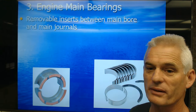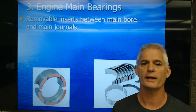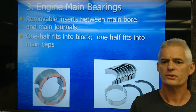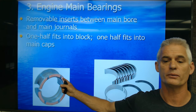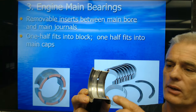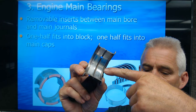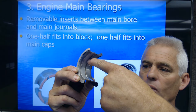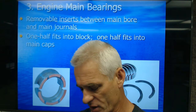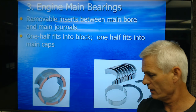I eventually figured it out. It actually ruined the crank — I had to take the oil pan off, drop the crank out, put in new bearings. Cost me $150 and a lot of time. One half of these main bearings fits up into the block and one fits down into the cap. The one that's up in the block has a groove — oil comes through the hole in the block, spreads out on the surface, and the crankshaft has a hole in it. When that hole lines up with this channel, oil goes through the crank and lubricates the rod bearings as well. Oil goes from the mains over to the rods.